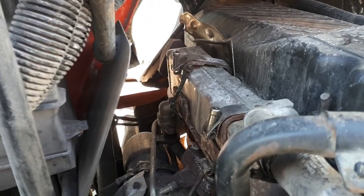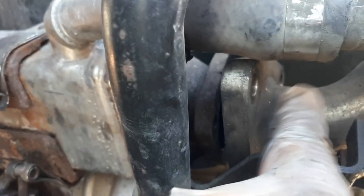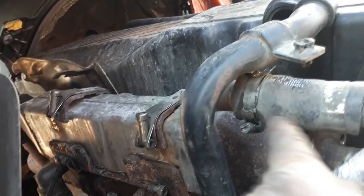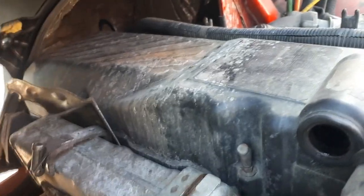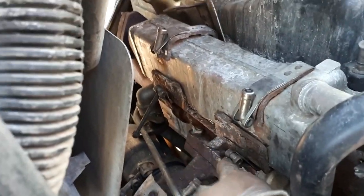I'm in a bit of a stuck situation right now. I believe I'm supposed to take off this bracket. I've disconnected the two clamps, taken off the three screws, and it's loose at the ends of the EGR cooler. I still have to take this off — it's where the coolant travels through. It is loose right now, so I'm going to try and pry it off. Hopefully I don't need to take this bracket off. These clamps look like they do bend, so they will let the EGR cooler come up.